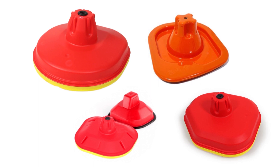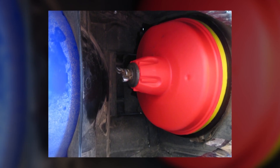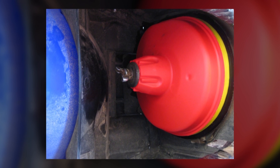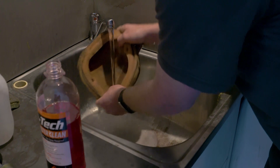The use of an air box cover while you're washing the bike is highly recommended. Pull the air filter out, put the air box cover in, wash the bike keeping the air filter dry. It's going to make your engine last a lot longer — especially since a wet air filter with an engine not getting up to full operating temperature is going to put rust or moisture all through your engine.